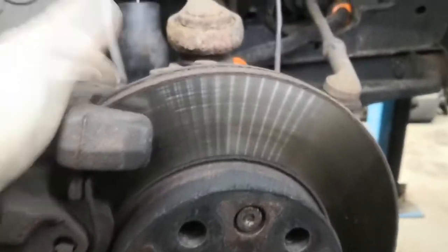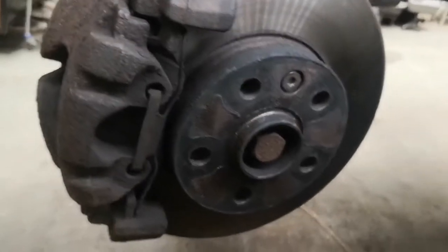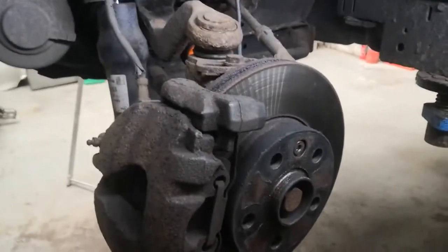If you're doing it on the floor it's going to be easier because you can wedge the bar against the floor. I'm on a ramp so I can't do that. Once those bolts are out, I'm going to undo the two M14 spline bits out of the bottom ball joint, pull that out of the way, and then that will allow me to pull the whole hub towards me. Then I'll be undoing this bolt here which is a 27mm, and once I've undone that — I've already taken the bolt out of the bottom shocker because I've just done the anti-roll bar bushes — you pull the hub out of the way and pull the driveshaft out of the back.